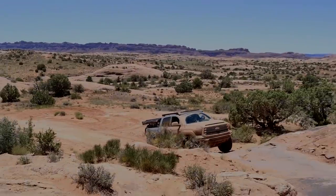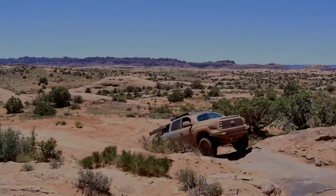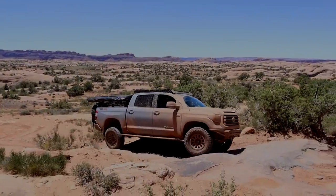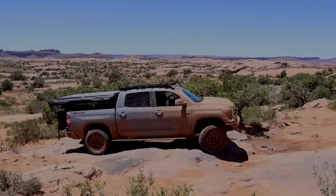That is kind of an advantage of this kit — it's very well dialed in. It gives you that two and a half inches around the truck that's adjustable, so you're able to fit 35s in there without rubbing. That comes down to what rims you're running and what your offset is, because your experience can be different from tire brand to tire brand. I'm running BFG KO2s. They don't actually measure a true 35 — they measure 34 and a half — and I'm running them on a plus-one offset fuel rim, with no rub, even if you bottom out the shock on rock crawling.